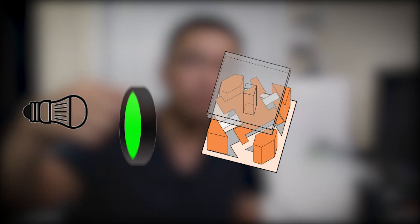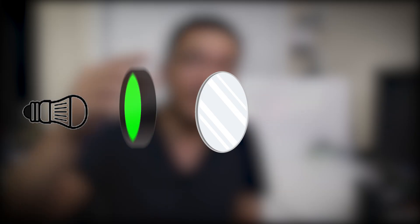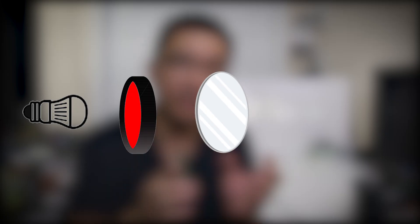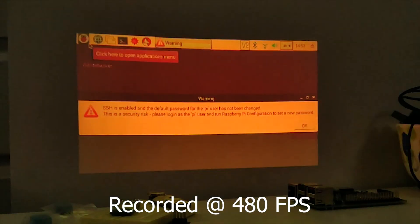What's good about these DLP projectors is that they use an LED that shoots through a light filter, then shoots to a DMD — a digital micro mirror device — and then projects it onto the wall. This little wafer of mirrors can actually move about 10 degrees each way very fast, causing the type of image you see behind me.